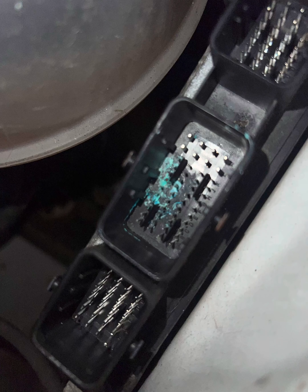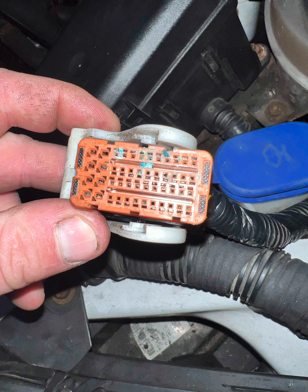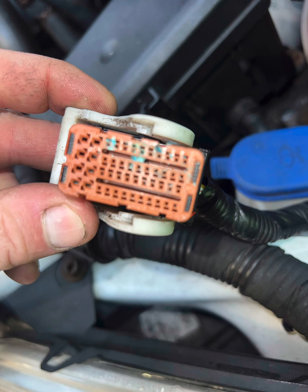Stripped it down, it's full of green. Here are the pictures. What I've had to do is go on a wiring diagram, show you the picture coming up with the pin - purple/green wire. That's for the engine control relay, the ground side of the relay. That pin's missing at the moment, so I've grounded that pin using the test light.